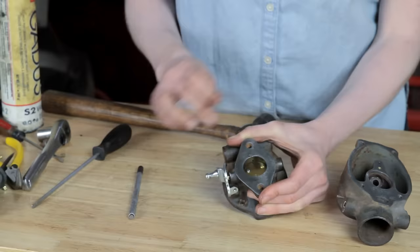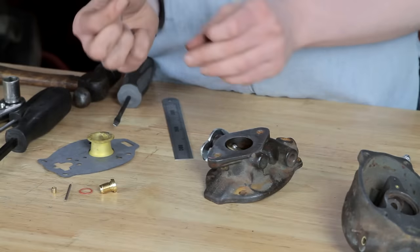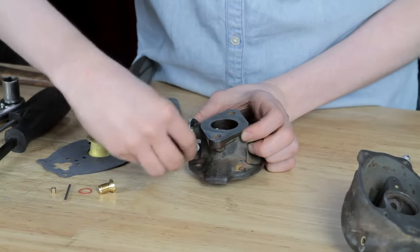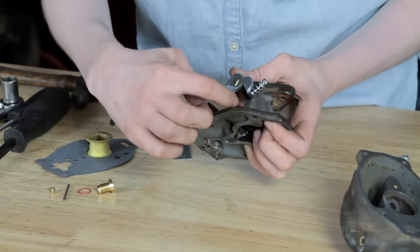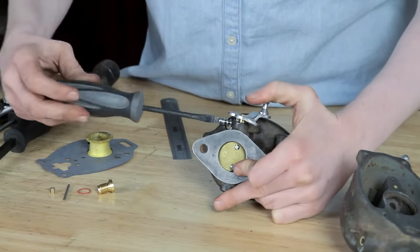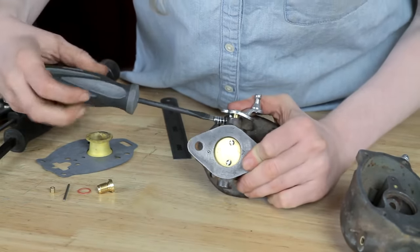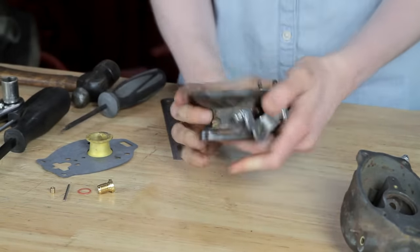There are two little screws and I like to use a self-starting screwdriver to get one started, then start the other, and tighten them both up. This is the idle set screw and it has a spring that goes around it, then it screws right here into the throttle shaft. I'm going to get this started with my fingers and then tighten it up with a screwdriver — tightening all the way until it reaches this little peg. Then I'm going to watch the butterfly, and as soon as we start to see that butterfly crack open is when I'll stop — just like that, I saw it move right there, and that's what you're watching for.